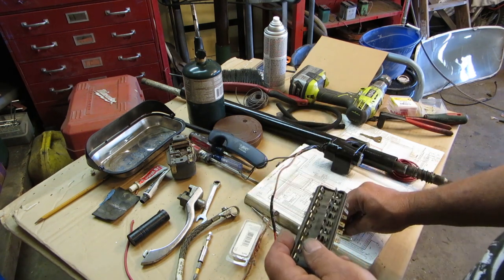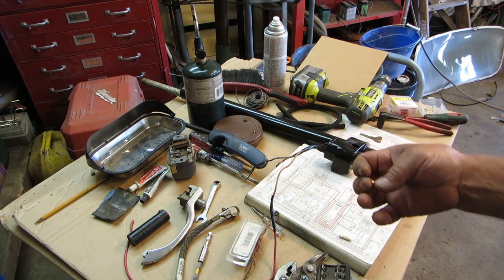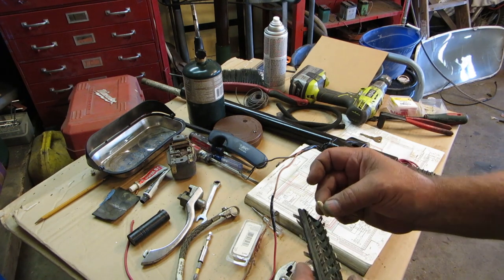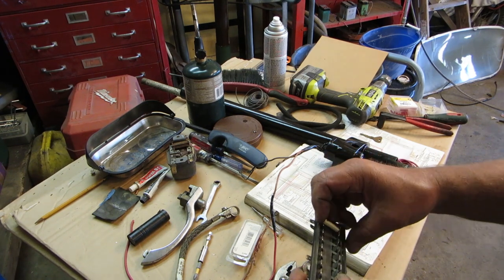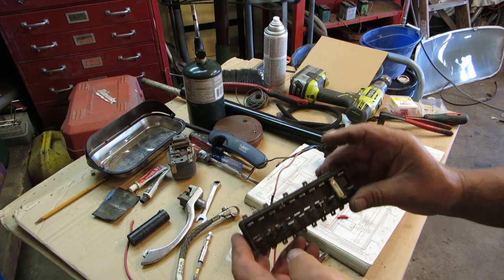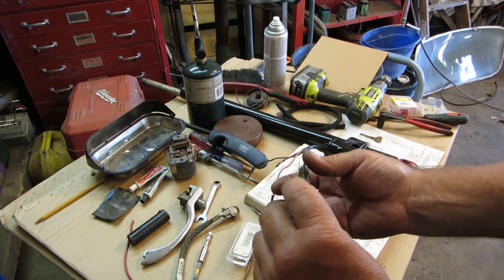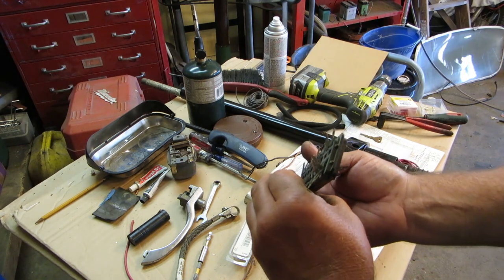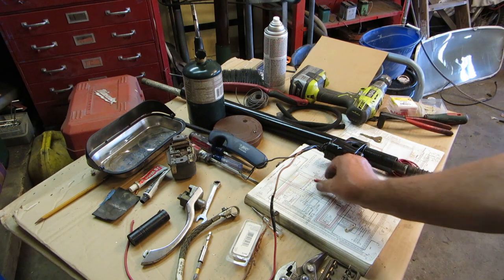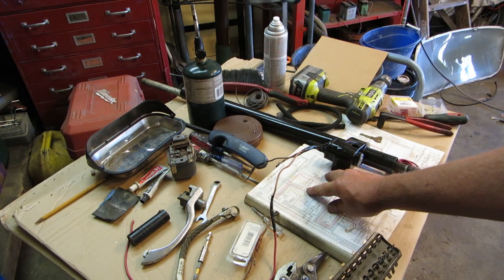We shined it up. There are two fuses that go in there. The red ones are 16 amp, and the white ones are 8 amp, and they fit in here as such. There is one 16 amp fuse that goes in there. There's also a cover over there that maybe if I pay the postage, my brother will send me. Hint, hint. There's one big fuse, and it goes on this wire right here, if you look. All the rest of them are 8.